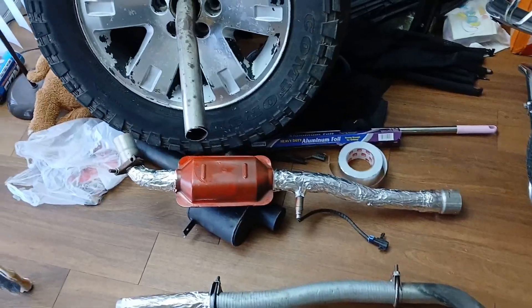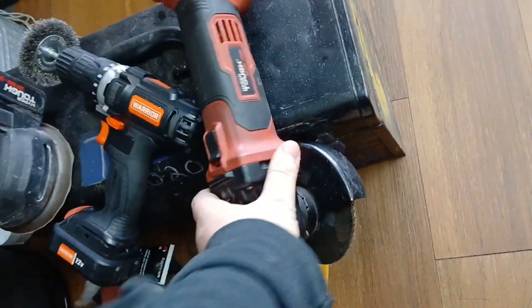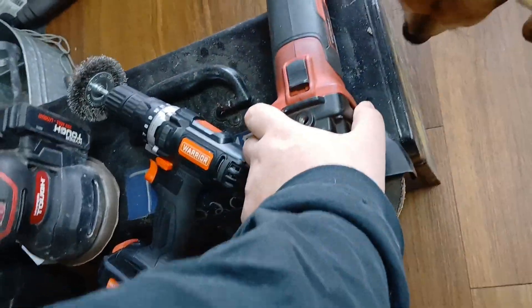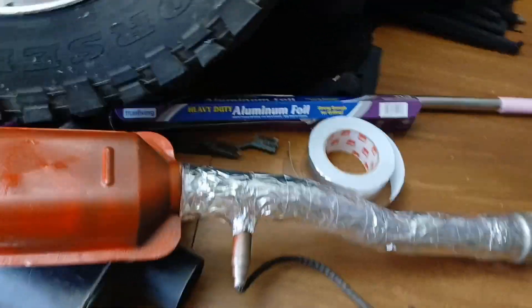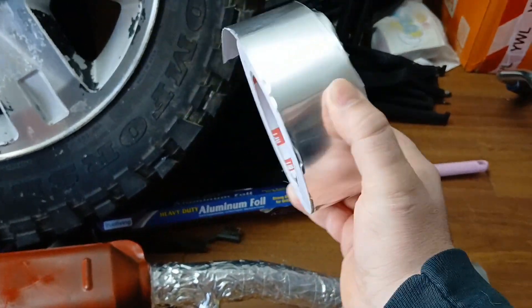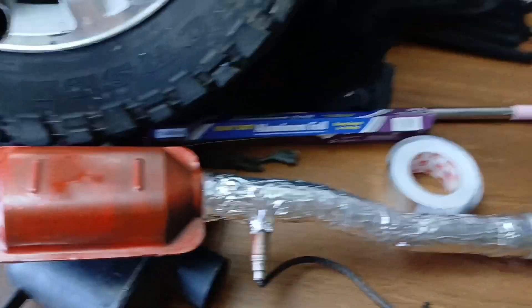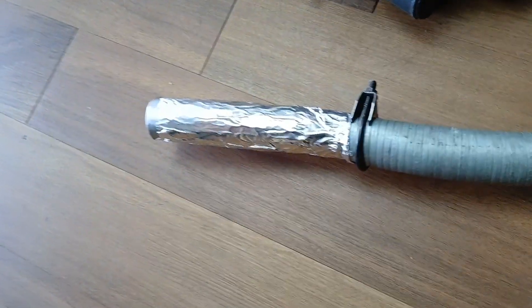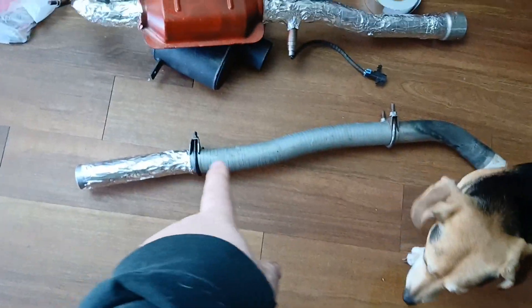After I got this piece cut off my exhaust, I went ahead and used a 36-grit flap disc on an angle grinder, a wire wheel, and a palm sander to clean up the exhaust. Then I wrapped it with aluminum foil. Then I finally went to Harbor Freight and got this stuff — it was like seven dollars, it's flame-resistant aluminum foil tape. Hopefully it actually works. I went ahead and wrapped my exhaust with that aluminum foil flame-resistant tape and squeezed it all together.